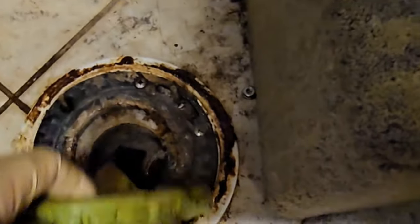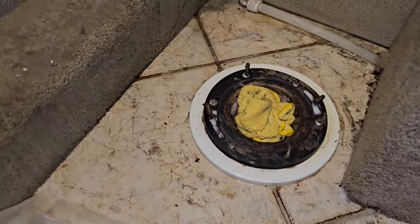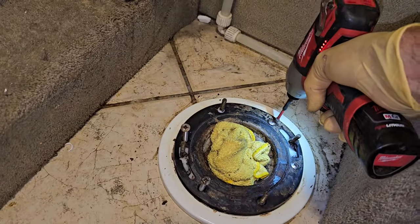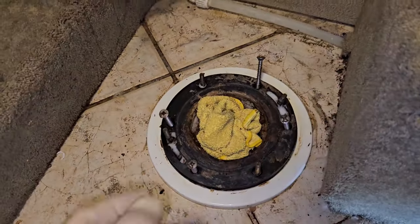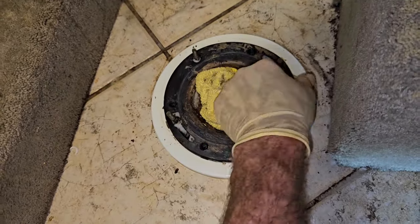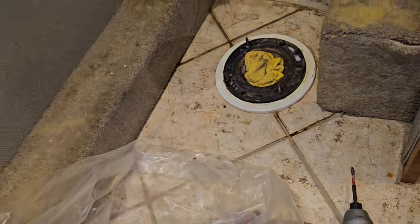Beaver coach, even though I love Beaver coach, it's also not uncommon for the floor flange to get rotten to the floor. Alright, so it's not much cleaner looking. So now I'm equally concerned that I'm going to have a bigger project than I expected to have. Because the new toilet's only going to be using 2 bolts and not 4, and these wouldn't line up where they need to be. So let me see what I can do.